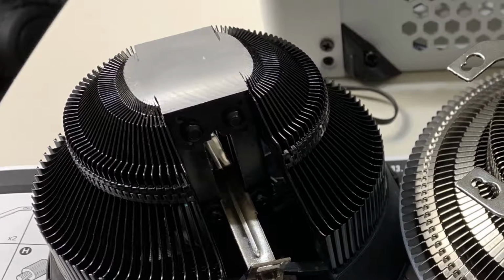Now the Dark Flash cooler I have in there now is all aluminum. There's no copper. The base plate of that specific CPU cooler is also aluminum, so there is no copper built into it whatsoever. So I invested in an upgraded CPU cooler that incorporated both aluminum as well as copper. And I went with the Cooler Master G100M, low profile CPU cooler.